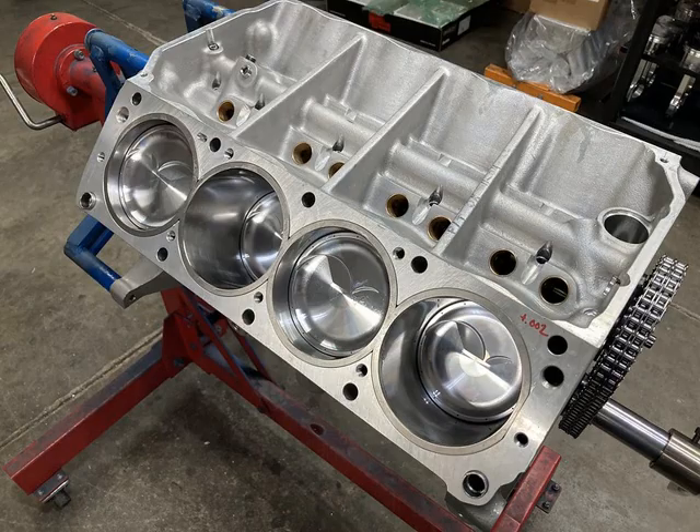The first pro is that aluminum blocks use sleeves — you can't have a piston riding against a bare aluminum surface. Most aluminum blocks, like this one, have ductile iron sleeves. The good thing is that if the sleeves wear out, you can press them out or cut them out and press in a new one to restore your bore size. With a cast iron block, once you bore and hone to the minimum cylinder wall thickness, that block is done — adding sleeves to a cast iron block is often too expensive and not feasible.